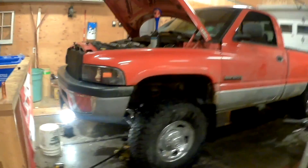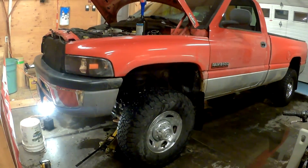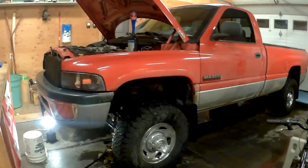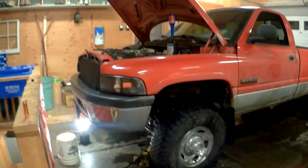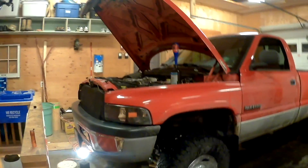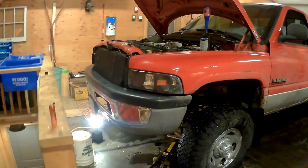That's pretty much a wrap. Maybe I'll make a video of me driving around with this Blue Top steering gearbox in — we'll see if it really makes a difference. The steering feels tighter already. I still got a bit of play, but it's in my steering shaft — the bearing's gone on the top, it clunks and stuff, and Dodge doesn't sell the parts separately so you gotta buy the whole unit. Hope you liked the video and hopefully it was informative. If you want a review of the Blue Top box, leave a comment and I'll compare it to my old one. Thanks guys.